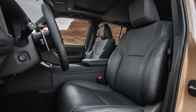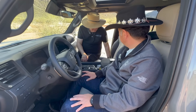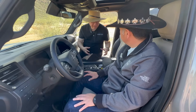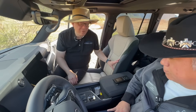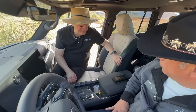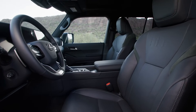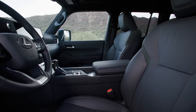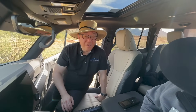The seat design is also different for the Overtrail model, designed to be more stable. The rear portion of the seat is a little firmer to give you stability. Interestingly, the side bolsters are actually a little softer than on other models — when you're off-roading, if the bolsters are too firm and hold your body too tightly, your head will move around too much. By making the side bolsters softer, your body can shift slightly, which is more comfortable and gives you the right positioning for off-road driving.